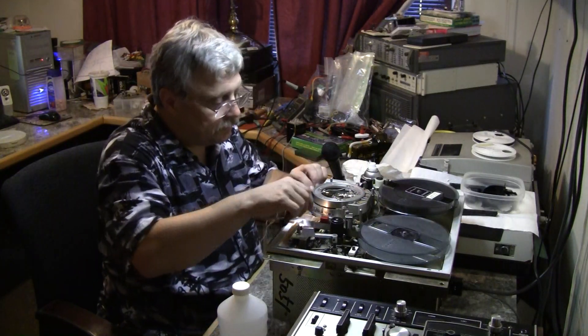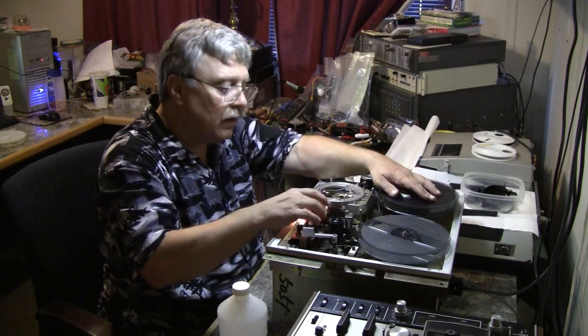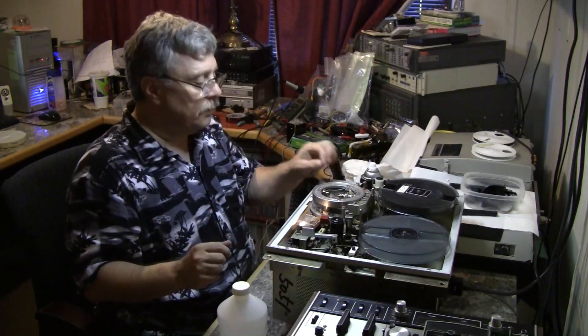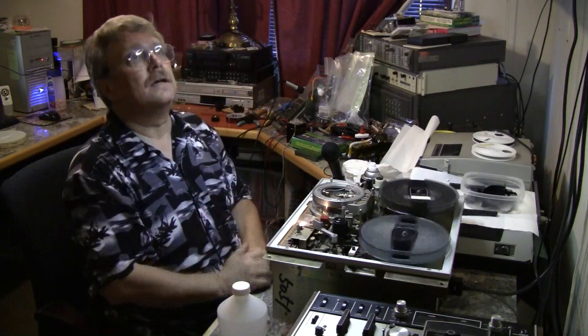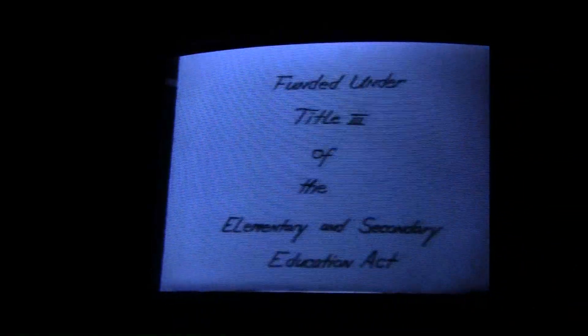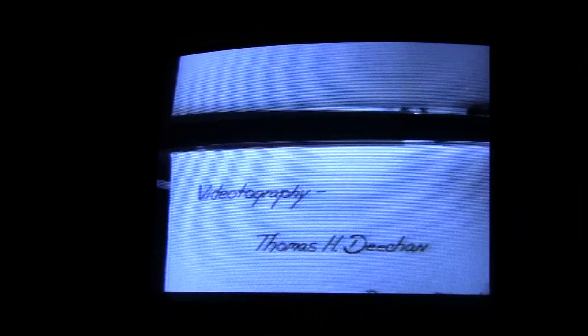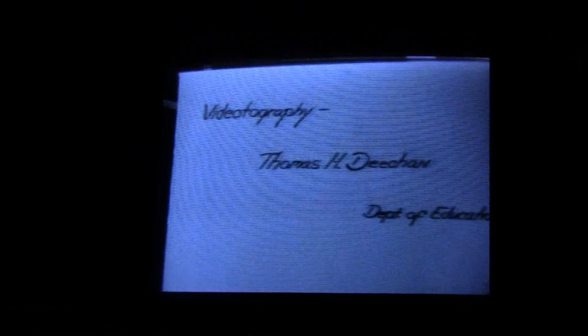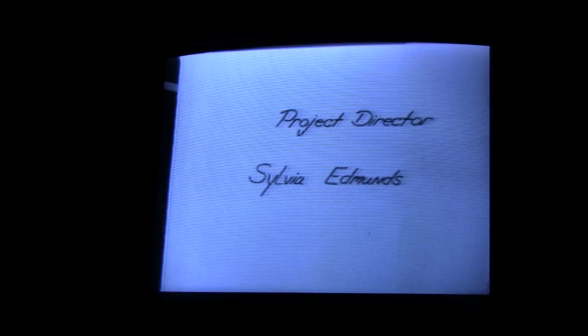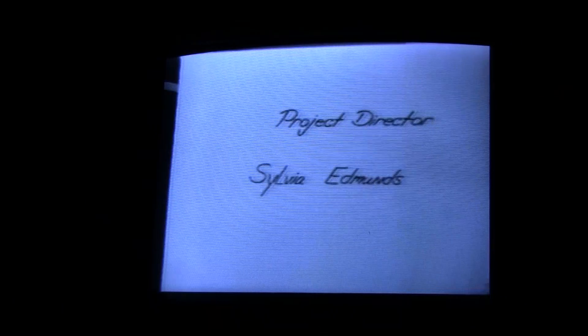Threading it back up — trying not to drop it into the greasy parts of the machine. Power on and play. This tape is playing very well, but notice it still has that vertical sync problem. I've got the vertical control set on this monitor very critically, and it appears to hold most of the time unless something extra black gets in the middle of the picture towards the horizontal center, and then the TV becomes confused as to which black part is the vertical sync.